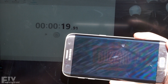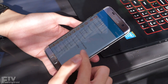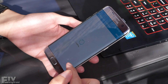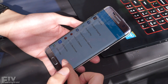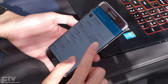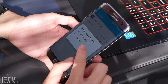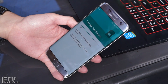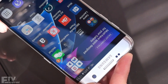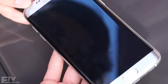So this is why we have to pair our new phones with a top-notch, super-fast card in order to achieve maximum performance. Now if you are using a Samsung Android device like me, you can't format the SD card as part of a system. But you can still head to Settings, Applications, and click any third-party app that you would like to move to the SD card. Then click Storage — you will see a Change button here if the app supports app to SD. Change to SD card. As we have already tested, the super-fast card will not affect loading time that much, so just move what you want. The only problem is when you take out the card, you won't be able to use those apps — you will have to insert it back in and they will simply go back to life.